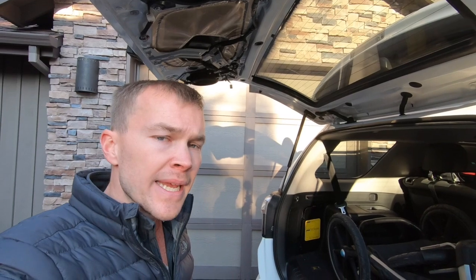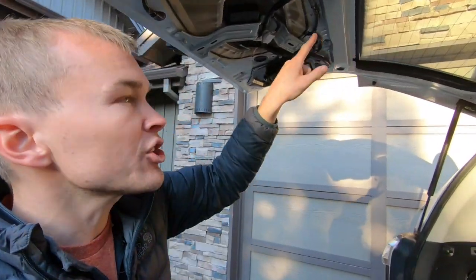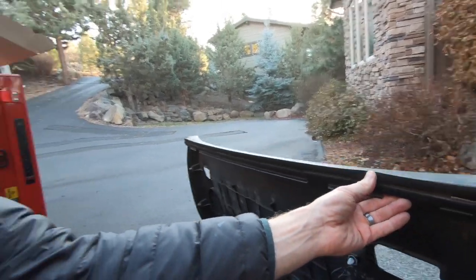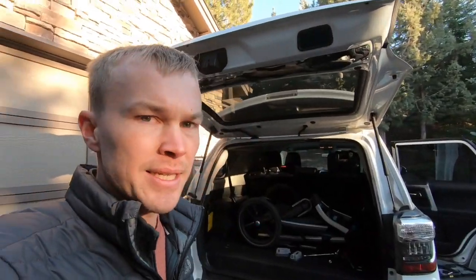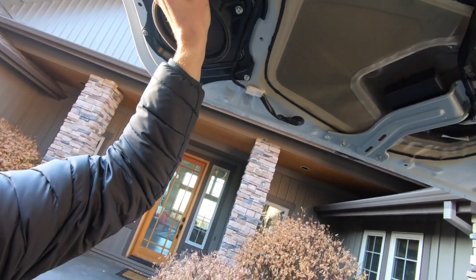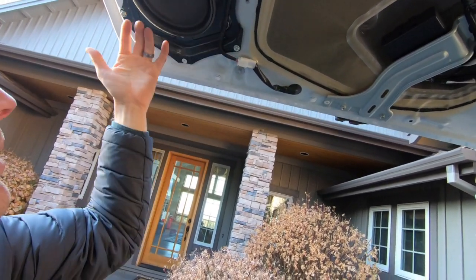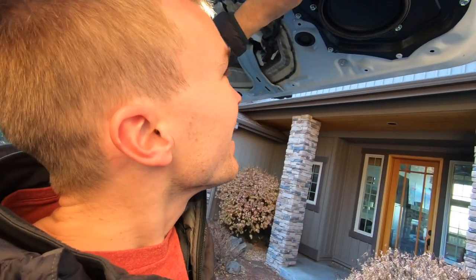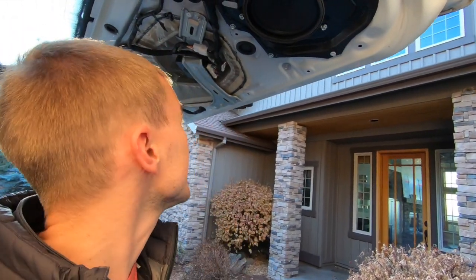One quick tip for the rear hatch to make it a little bit easier. I thought that the installation was going to be the same back here as on the doors up front where you're basically yanking outward and there's little clips that insert. On the rear hatch it actually rests on this little lip at the top so you're not actually pulling it out — you're just lifting it up over that. See if we look at the top here — just this little plastic edge that rests on there. So be careful when you're removing that — don't yank on it, just lift it up and it'll just easily pop right off. Once we've got that off we can see the two rear hatch speakers. A little electrical connection up here at the top — just push on that and pull it out — and then we've got the three bolts to remove. Remove it, reinstall the new one and then likewise do the same thing over here. Just connect this electrical connection and remove the three bolts. Put in the new speaker — pretty easy. Once we've done that then we'll just put it back together the way we took it apart, putting the top piece on first and then pushing in the clips starting on the sides and then the bottom last.